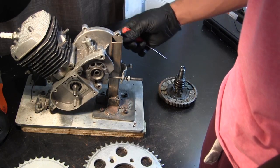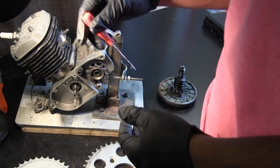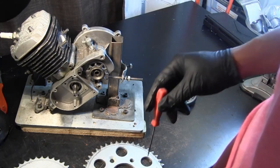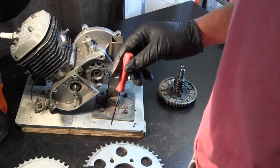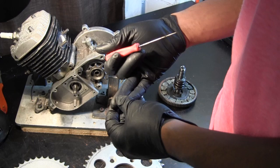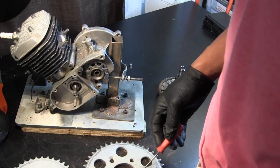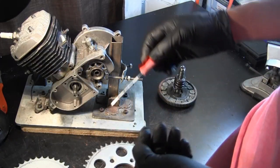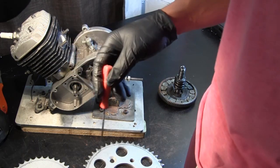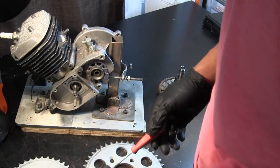Now that you have an idea of how these gear ratios work, you can do your calculations and decide which rear sprocket to buy. The key things to consider are your weight and, most importantly, your riding environment. If you're in a hilly environment, you definitely want a bigger sprocket for the power to get up hills. If you're in an urban environment, opt for higher top speed cruising — you won't need as much torque, so go for a 41-tooth or something like a 38-tooth.